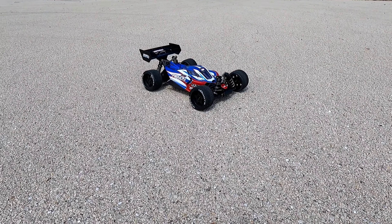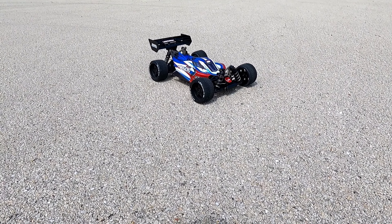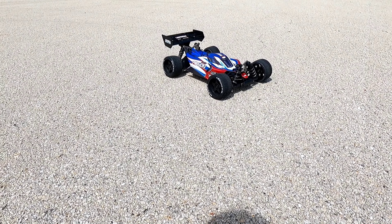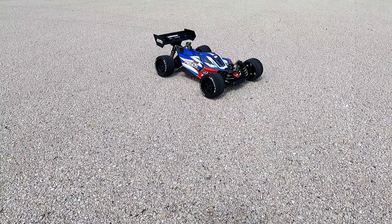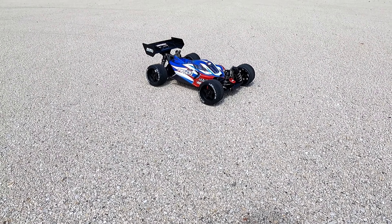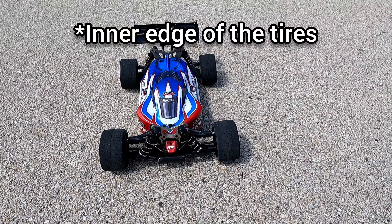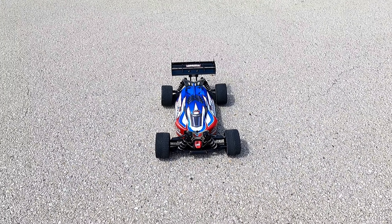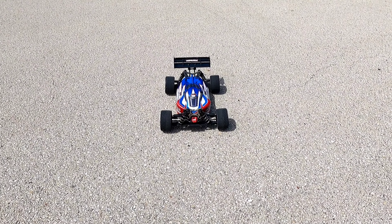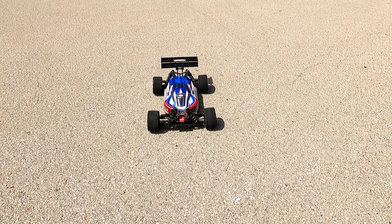Not as good as I expected, but the suspension is probably still set up for off-road, and I'm probably not good enough of a driver — but still a lot of understeer. Looks amazing though, and it's a lot of fun to drive. Looks like I was really only wearing on the outer edge of the tires. Probably need to adjust the camber a little bit, maybe get a little more footprint on the ground. Might help a little bit, not so sure.